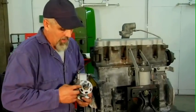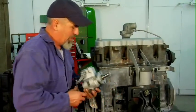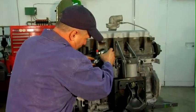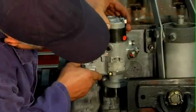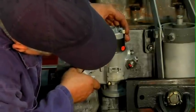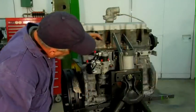We've got the pump timed, and I've got the o-ring here — the sealing ring that fits down into the groove in the block. I'm going to just lower the pump down in, and move it slightly till it meets up with the drive gear down inside.